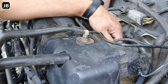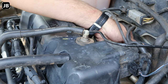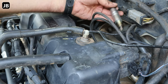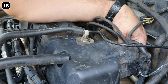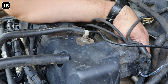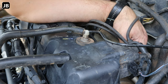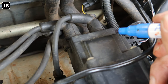As I said, it's got a bit of hesitation and misfire. So it's either the coil, the ignition leads, or a bad plug. This one is also not in a bad state, so we can still run them. If anything happens, I'll just change them out. At least none of them is dead.